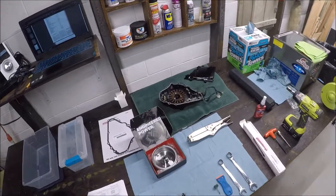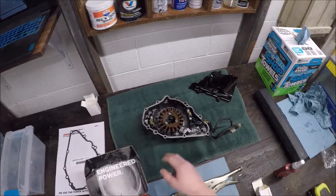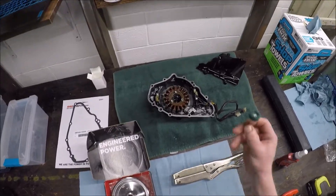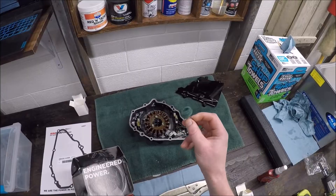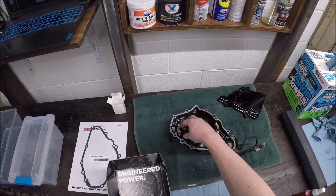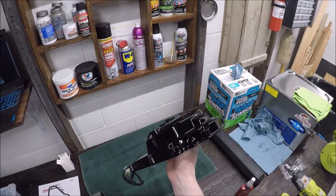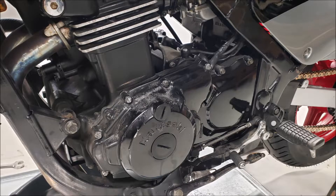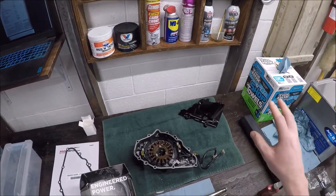Before I even got there, I removed the lower fairing and drained the oil. I had to remove the 30-year-old gasket — the way I do it is take a plastic blade and a Dremel and go around and clean it up. These kind of disintegrate and throw stuff all over, so I didn't want any of that getting into the engine. Before doing that, I pulled the stator out completely. This piece had been completely destroyed by a leaky fuel petcock and the paint was ruined.